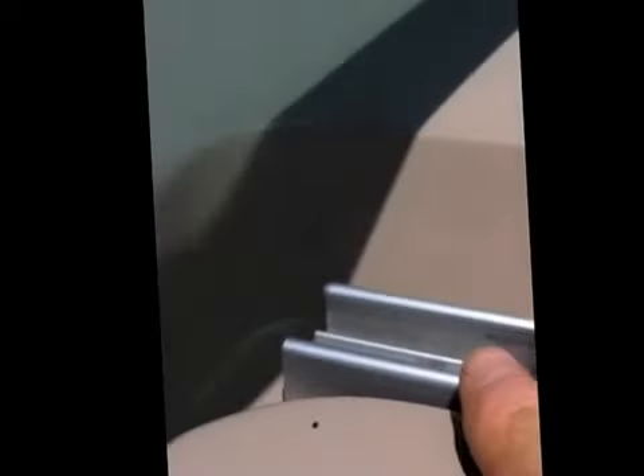With the door trim off, you've got the edge of the upholstery exposed. To get the door trim off, I had to take off the stainless steel stepping plate, which goes on there — a couple of screws — and also the door retainer, which is just held on by a couple of screws as well. I also had to loosen off the top track of the door, which is up here. The screws are actually inside the drive cowling, which houses all the gauge instruments and so forth.